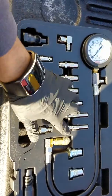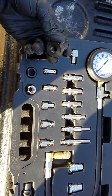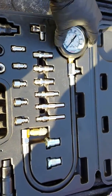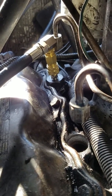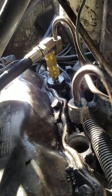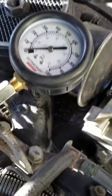Since we already have the injectors out, we're going to go this route using this dummy plug to test it. That plug or block fits perfect. You got the fitting for the gauge — here's the gauge. We're going to check the compression.